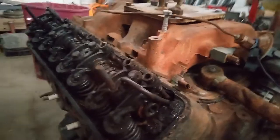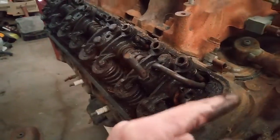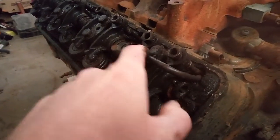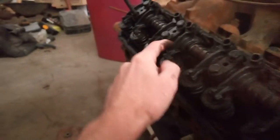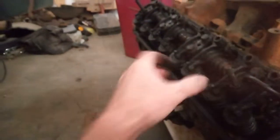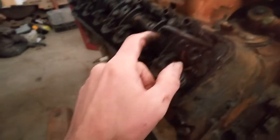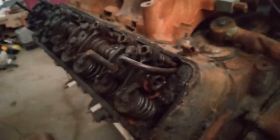Anyway, he has a method that you take this out and he says throw it away. And then you tap this out and put a bolt, a little 1/4-inch bolt down in there. And it totally pressurizes this, turns these into sprinklers like a Rain Bird, and it just sprays the oil everywhere. And he says, and I trust him because he knows this stuff, you get enough splashback that goes back and oils your distributor and timing gear still.